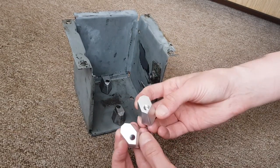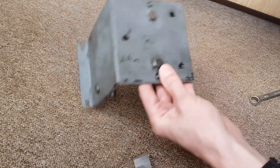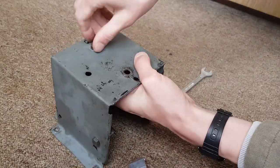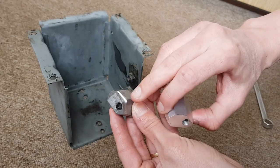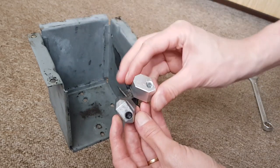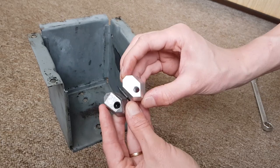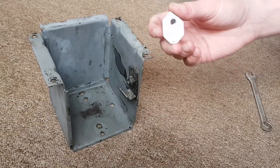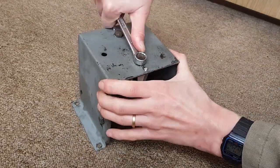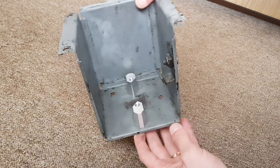So I've got these new aluminium guides - the ones that are in the box are quite worn and I'll show you those when I take them off. To take them out there's just two bolts here and they're 13mm. You can see the wear across here - that's where the bottom of the forks rub against the guides. Over time it's just slowly worn away. They just fit in the same position on both sides and then the bolt just screws up. That's the new guides in position.